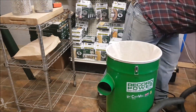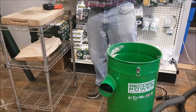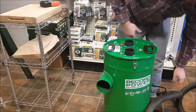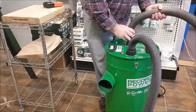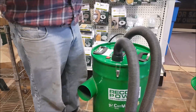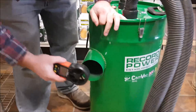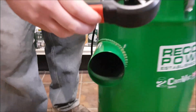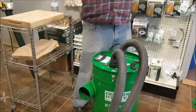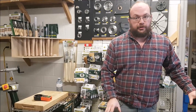So now with the NanoMax CV — as I mentioned, all the cloth filters and paper filters you don't need, so you can set those aside. This will sit in that canister just like that. We'll do that same test. We were at 521 with the original filters. Now we're about 599.2, so not quite 600 — that's about an 80 CFM increase approximately, comparing the two different kinds of filters, which is pretty good. Every little bit counts.